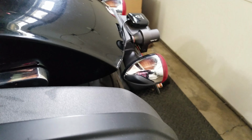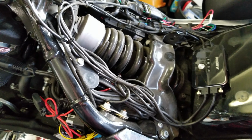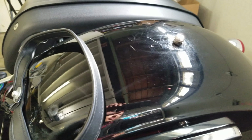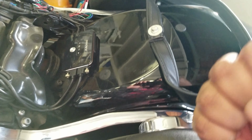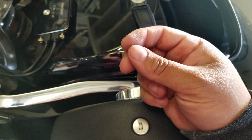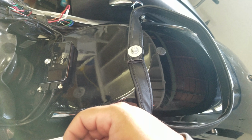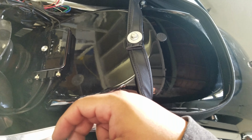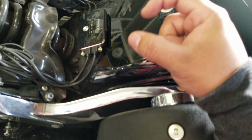Now, under the motorcycle, I have what are called cable organizers. They have double-sided tape, and I put a couple on spots around here and here, and it has a hook type that just holds the cable so it doesn't come off. Make sure you clean it because of dirt and grime, and then put on the cable organizer. I can't remember what they call it right now. I think they're called clamp organizers. And then you just stick it on, move it around, make sure it doesn't move right away. If it moves, that means it's not clean enough, or you might have to get something else or wire them through somewhere else. Then you put in the cable, and it secures it very, very well.